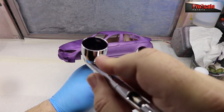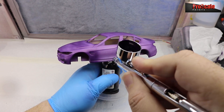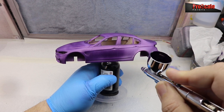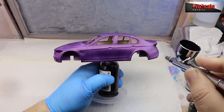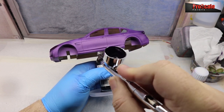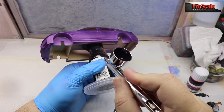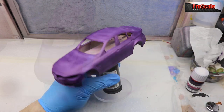So there's the first coat done. Between coats we're going to alternate from going side to side to up and down so we get into all those nooks and crannies and panel lines. As you can see I'm not hosing the paint on — nice thin coats, building up. I always do a pass along the sill at the bottom and a pass along the door shuts at the top as well. That's the HPC Plus done — switching over to my Revolution and you'll see the coverage gets instantly better.